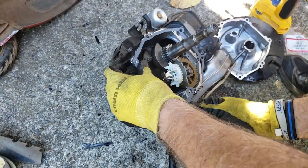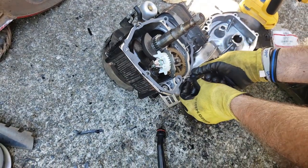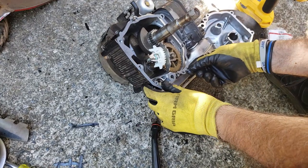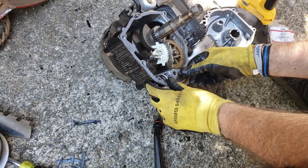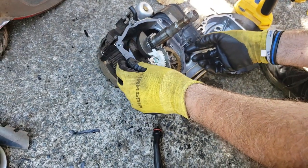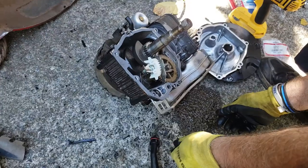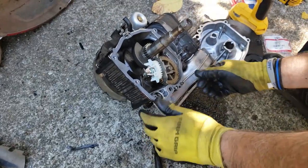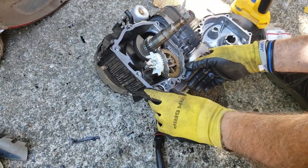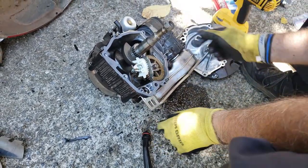It's very irritating that that broke. And we might very well end up with a leak again. This would be a case where, if you had Permatex or some other kind of liquid gasket, this would be a good time to use that. Right, especially where it broke there. If you really wanted to, you can do it around all the bolt holes or at least the corners.